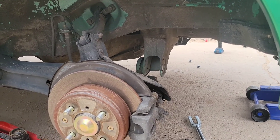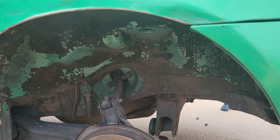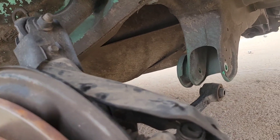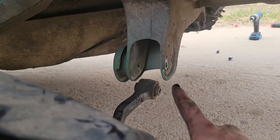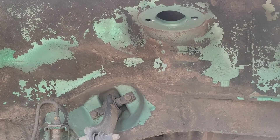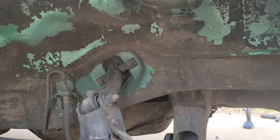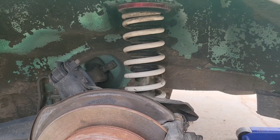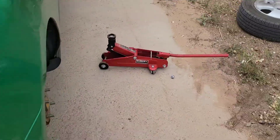Just got the first rear one done and it was so difficult trying to get the stock one out of there, just because it's a whole lot longer than a lowered coilover type thing, so you really got to work it. I even had to take the lower control arm out, and that gave me just enough clearance to drop the whole stock coilover. I'm going to go and get the other side and continue.